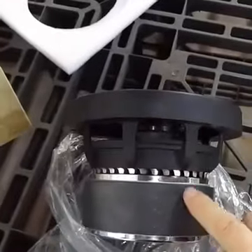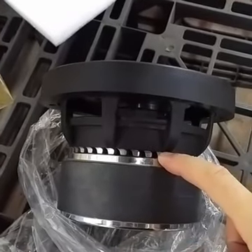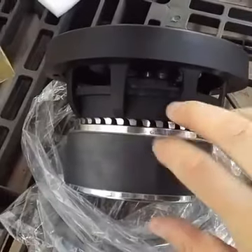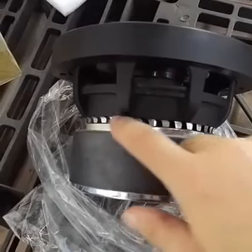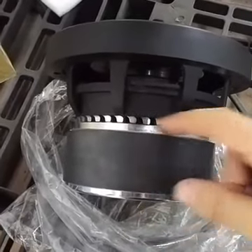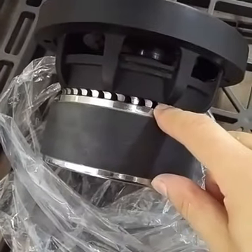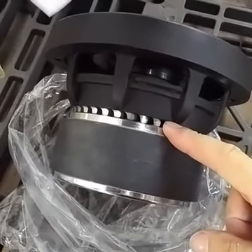That aluminum piece serves several purposes, but yes, that is part of the cooling. I can't really vent the top plate — it's not that very big — and the basket also has some limitations with that. So the way this cooling is designed, that's where all the air is coming through. It can be pulled in this way but also blown out this way. Most of it is sucked in and then pushed out from the pole vent. This being conductive, any heat that is built up on the top plate or in that area, the aluminum will dissipate that as well — it kind of works like a heat sink.